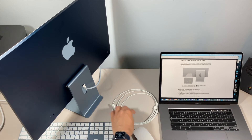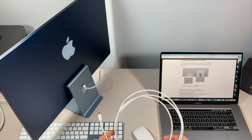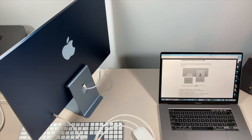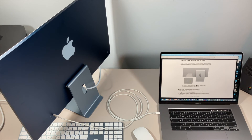This doesn't matter if you're using a 2-port or 4-port version of the new iMac — it's still the one closest to the magnetic cord. You can use any USB-C 3 cable, or what I always like to use is a USB-C charge cable from a MacBook Pro, MacBook Air, or any MacBook. You can also use a USB-C to USB-A cord if you have an older 2015 or below Mac without USB-C. You just need to be running macOS Catalina 10.15.6 or newer and the latest version of Apple Configurator 2 that your Mac supports.